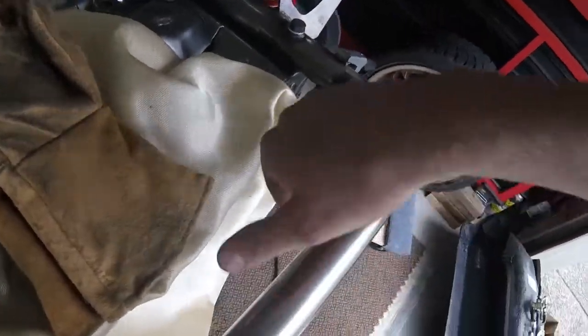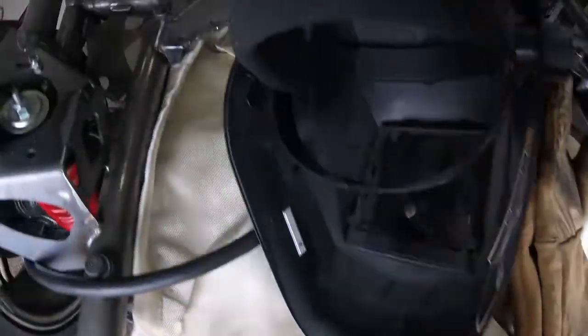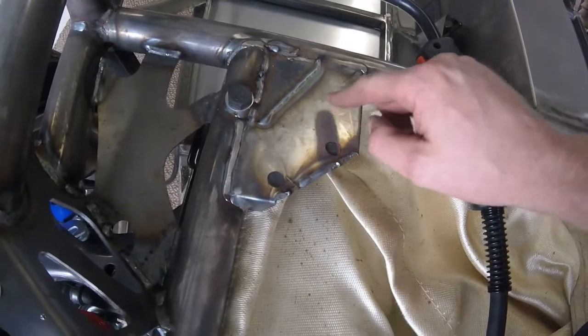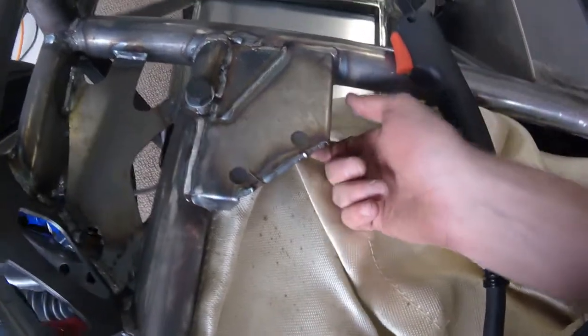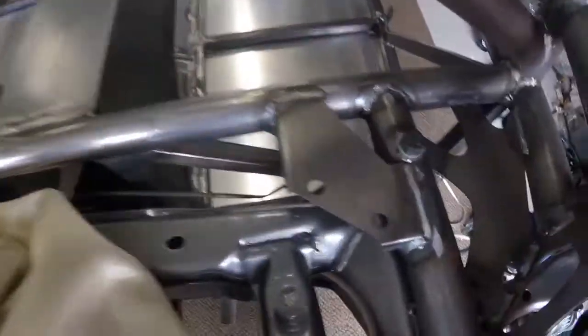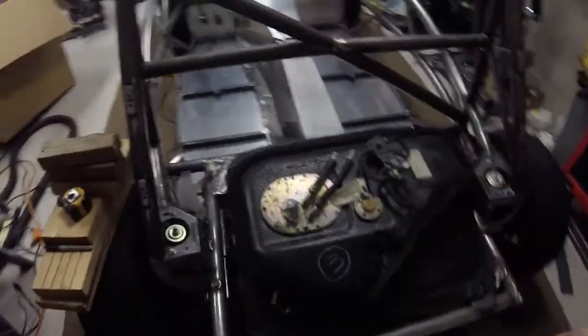I'll give you a quick overview: I have this plate welded in along the edge and also underneath to these frame tubes. Same with this one here. The passenger front tank mount — excuse my bad welds, I forgot to turn my gas on — has an eighth inch plate under the whole area. Once the frame is removed I'll be tacking it underneath all the way around and cleaning up my welds. As you can see there's quite a bit more support there and none of the flex that there was before — as hard as I push on it I can't get it to flinch.